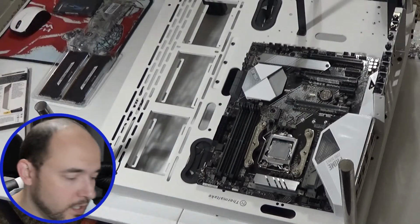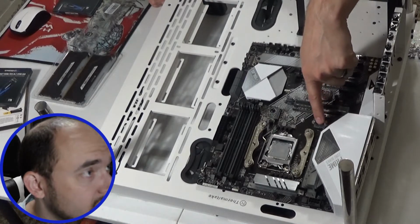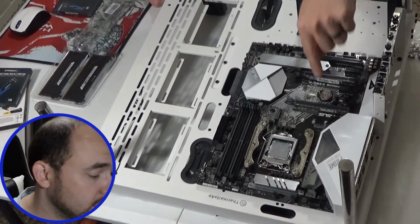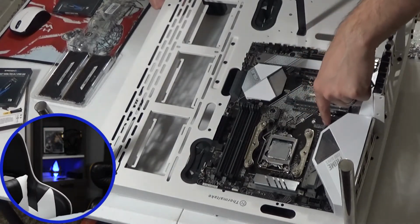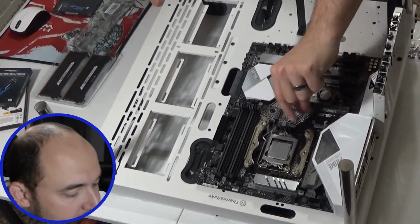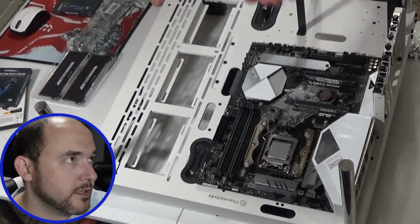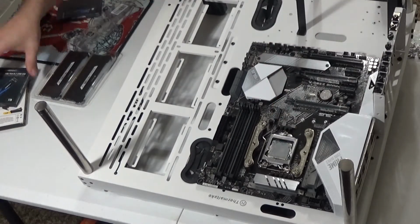Now this one requires that I place a screw right here. It's a little pin, just like the ones that are in the motherboard underneath holding up the stand. You want to screw it in. There's different sizes, and this one is a 2280, and so I'm going to screw in the pin right there, so that way when the SSD card is inserted, it rests right on top and I can screw it in perfectly without any pressure hurting the joint right here. So go ahead and do that. I have my M.2 SSD and I have the screw for it.